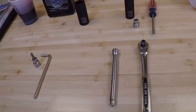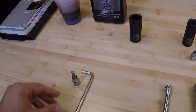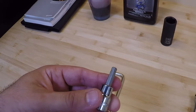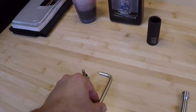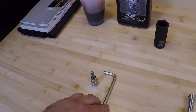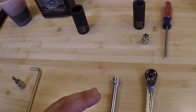As far as tools you're going to need: obviously a drain pan to catch the fluid — you're only taking two quarts out. For getting the plug off the bottom of the transmission you're going to need a 6-millimeter Allen key. Preferably one designed to go on a ratchet — you get a little more leverage that way, making it easier to get the drain plug off. They will get pretty tight over time. You can also use a regular Allen key with a vice grip or pipe for extra leverage to crack it loose.